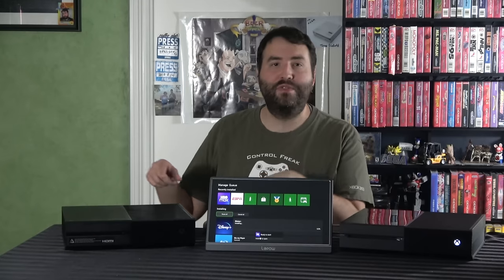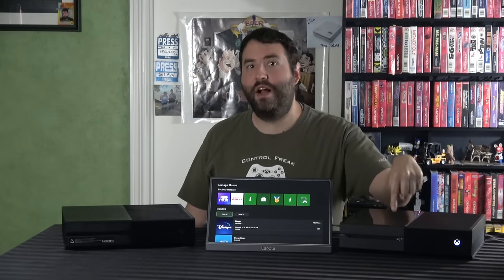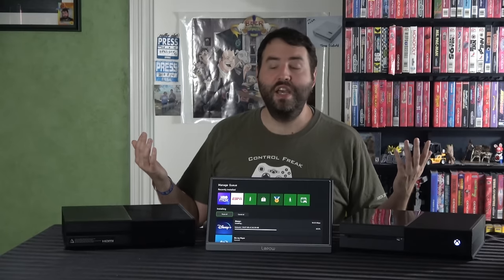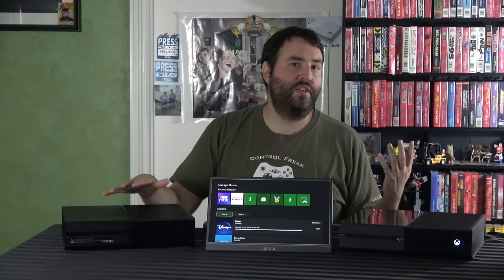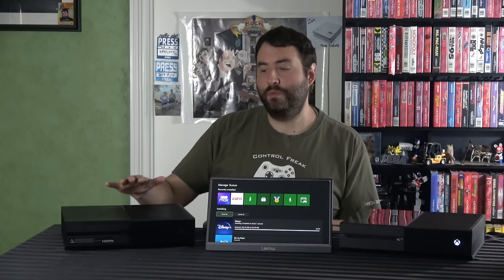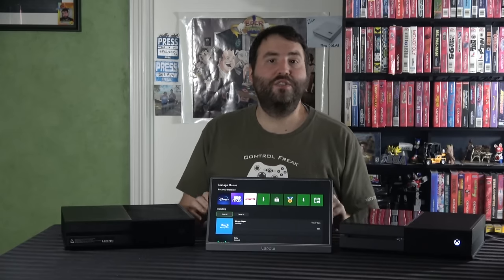While I've got your attention — talking about the base VCR Xbox One — if you run into a different issue: there's one that is very commonly solved which I've actually run into on this unit, which is when you put a disc in, sometimes the console just can't acknowledge the disc. It has to do with the disc loading device, not necessarily the laser. There's actually a very simple fix: if you just kind of lift the console like that when you put the disc in, gravity compensates for the problem and it's able to load the disc.